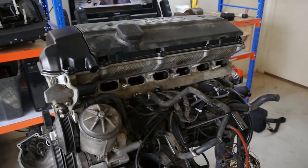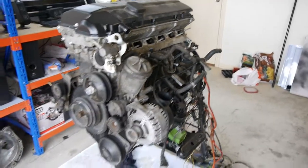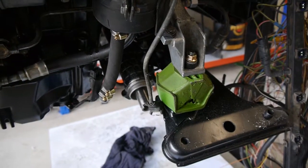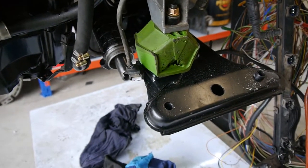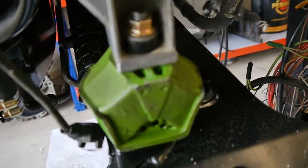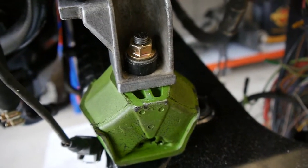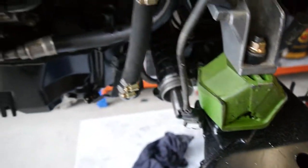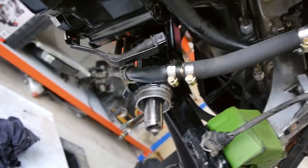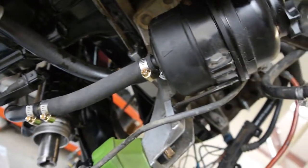Pretty good race on top of the mountain, but that's all done. For the rest of the year this is going to be my primary concern, so let's get into episode five. The steering rack and crossmember are all done — bolted up. You can see the little spacer I built because the shank goes too far through, so I built a spacer and got the nut on. You can also see the power steering lines — I just cut that off, got a piece to slip in, and extended it, so that's all done.